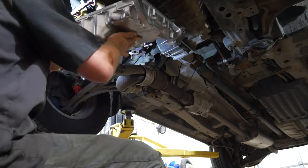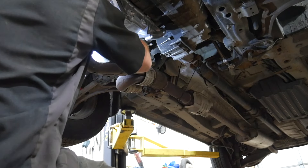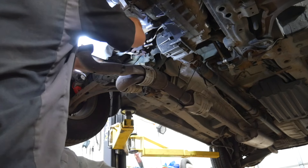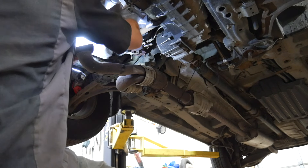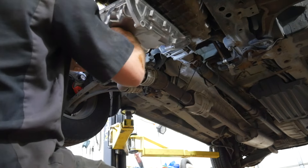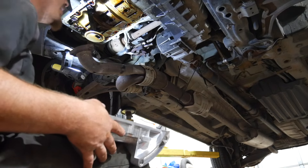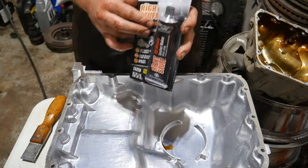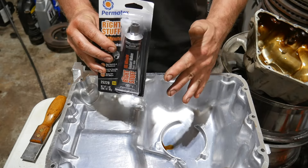This step you wouldn't really have to do, but I just like to do it before I put silicone on stuff so I know which way to lift the thing and I'm not going to smear silicone all over. I have done this without testing it first and you get jammed up and then have to clean off all the silicone — this just makes your life a little bit easier. You can see it is a little tight in here with our oil pickup. It's time to seal up this oil pan. I'm going to be using the Right Stuff Black RTV, which is really, really good stuff.